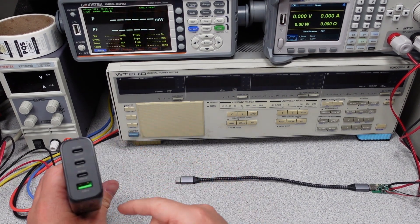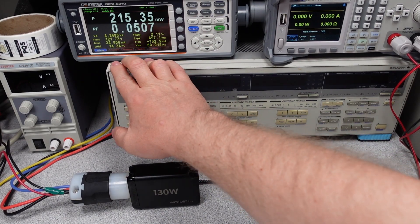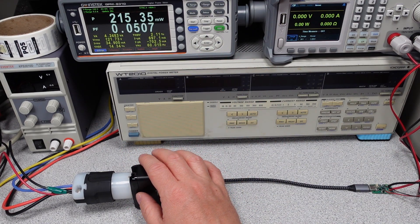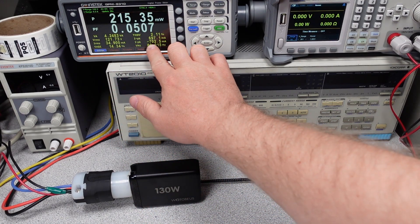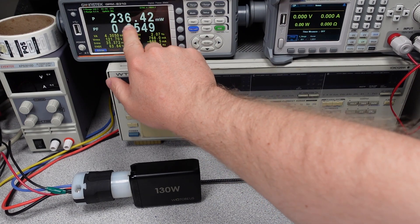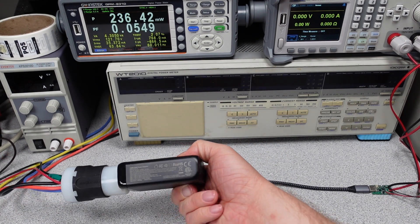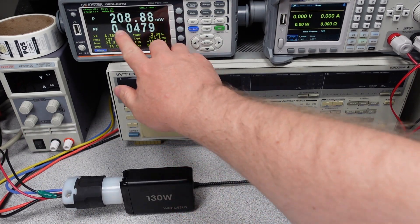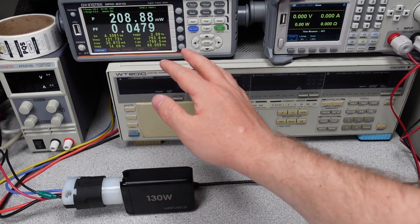This one does not have any LED indication when plugged in. I had to set up a longer averaging time to get everything to stabilize. The idle power consumption is a little high but better than some other adapters in this higher power class. There's a little fluctuation so the peak current is slightly elevated at idle. The idle power bounces around — sometimes it passes and sometimes it doesn't pass the DOE 6 efficiency standard. This adapter doesn't claim DOE 6 compliance, so they aren't trying to say it meets it, though at times it does and at other times it draws a bit more power.